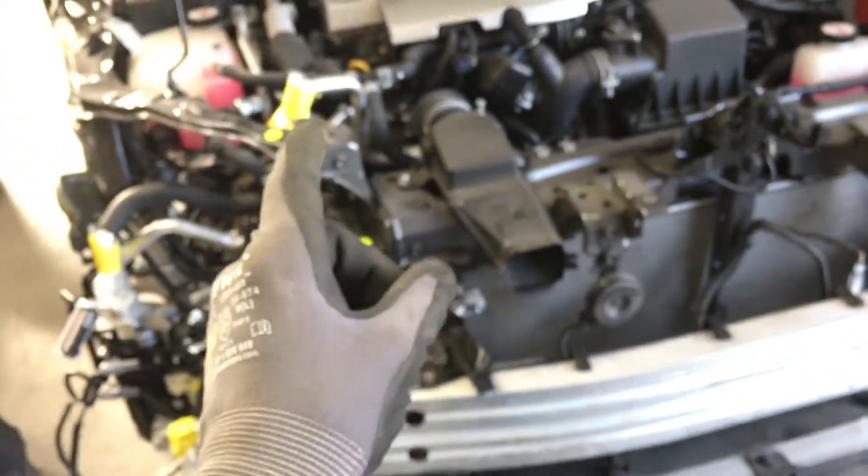If you improperly charge one of these Prius vehicles — you guys who believe in using the little cans, don't believe in evacuating, or believe in using shop air to look for leaks — just keep doing that on this vehicle and let's see what happens. Especially if I get a hold of one of those vehicles and start testing the oil, refrigerant, air contamination, moisture contamination — I will give the customer all that information, and you the shop or individual will be paying for that customer's repair.